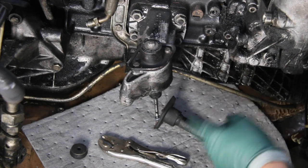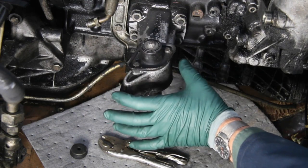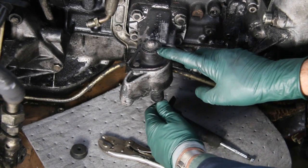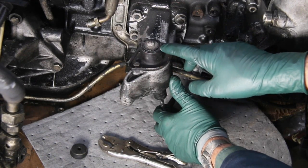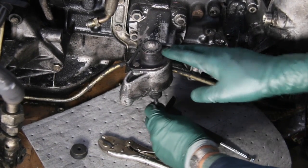There are two things you need to be concerned about. You need to be concerned about the mounting rubber. Right up here, this bracket is mounted to the motor mount arm and it has a rubber insert right there. If you start moving the shock around and there are excessive cracks, or if it's loose, you've got to replace it - though you'll have to decide; this one might still have some life to it.